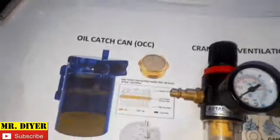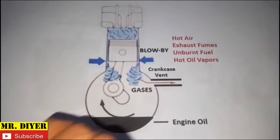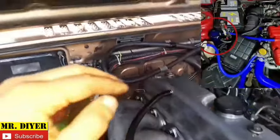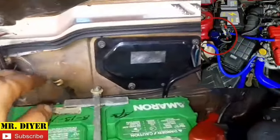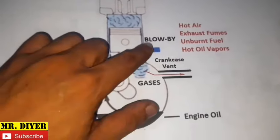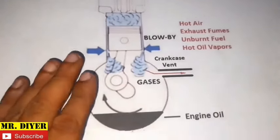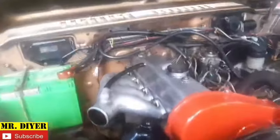So it's the same with the OCC. Why is this important? Like I said in the beginning, you want blow-by gases out of the crankcase as quickly as possible. That is why you just have a short hose from the crankcase to the intake. But if you install an OCC, you will need a much longer hose — one from the crankcase to the OCC, and another longer hose towards the intake. And that will impede or slow down the flow of blow-by gases from your crankcase. The result: if you allow blow-by gases to linger inside your crankcase, that will make your engine oil hotter, mix with your engine oil, ruin the proper viscosity of the oil, and your engine will lose its proper lubrication — hence your engine wears out much sooner. So you may have prevented oil from contaminating your intake by installing an OCC, but in so doing, your engine wears out sooner.